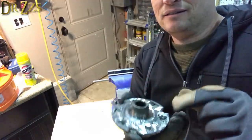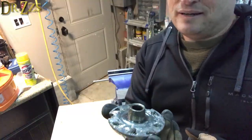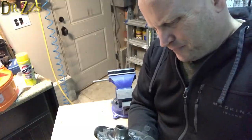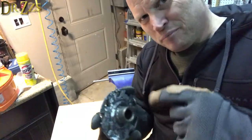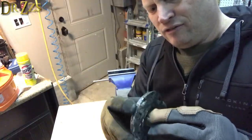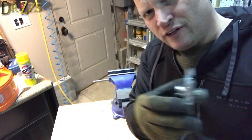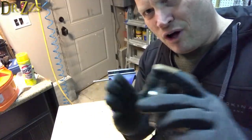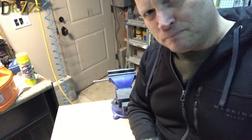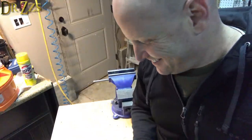To do that, I thought maybe you could weld this on there, on the transmission shaft. I don't think I want to do that. I think instead I'd rather maybe just put a couple of bumps with the welder on the transmission shaft. So this will still slide on and off. But when it hits those weld spots on the transmission shaft, it won't go on any further and it won't be able to come off of the gear on the motor. So that's what I'm gonna do. Just like the book says, this is exactly how you do it according to the book. There's no book.